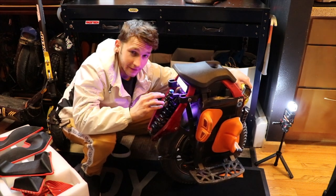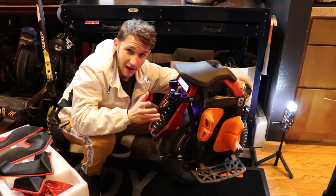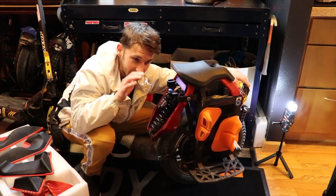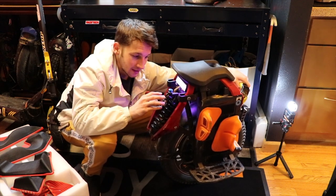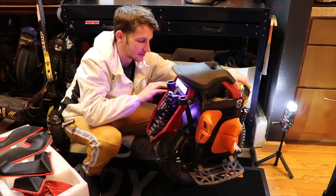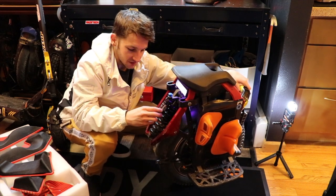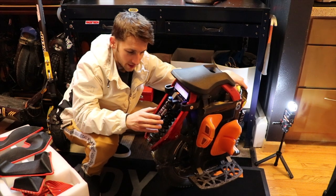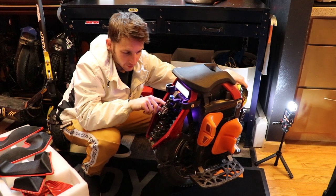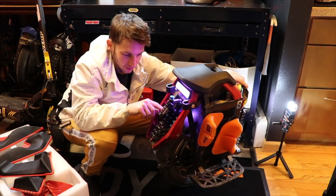But that's literally your suspension sinking down and engaging and acting like it would on a mountain bike, where you'd get that same effect back there, going into a corner, getting that braking bump chattering. I even talked about it, saying that it wouldn't happen on trails, but now that I adjusted it, the suspension actually loosened up over time, guys, in a good way. So my preload on here, I noticed that over time I'd actually have to tighten my preload up and move it down.